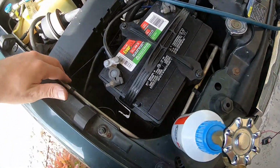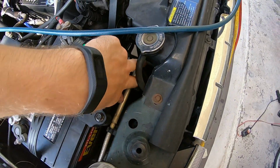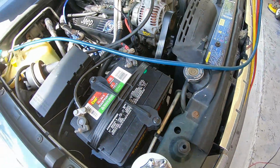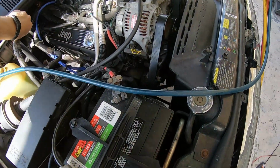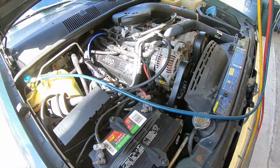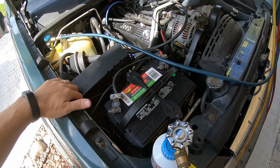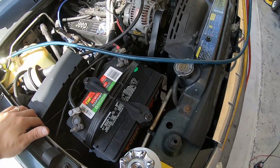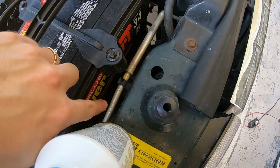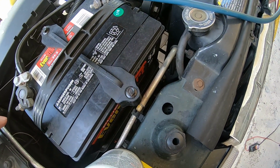Oh, interesting. Okay. So the high side is sweating here. I wonder where the orifice tube is. It should be sweating right after the orifice tube. It's not sweating here, but it is sweating here. I wonder if the orifice tube is right in there. It's kind of an odd place to put it.